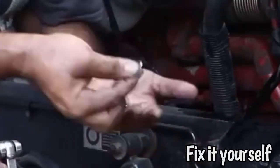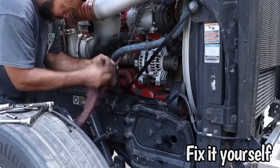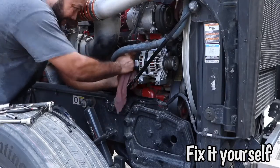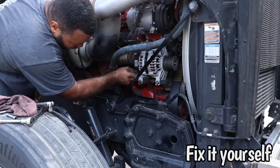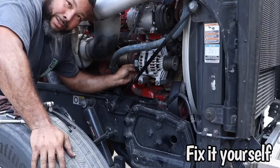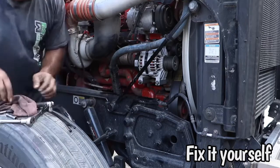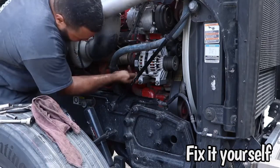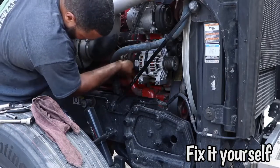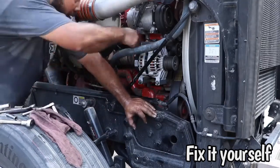This is what you call a lock washer nut. You need to put the cable on first. Wipe it off — let's get no corrosion. Got that on. Now you put the lock washer on, then you put the nut. The purpose for the lock washer is: when you tighten it, it pushes the lock washer together so it bends back towards the nut, so you don't ever have to worry about the nut vibrating loose. Got everything hooked up.